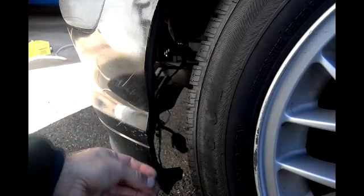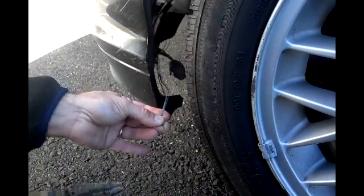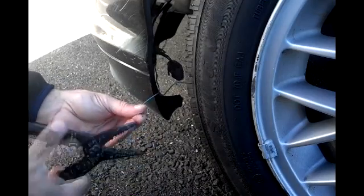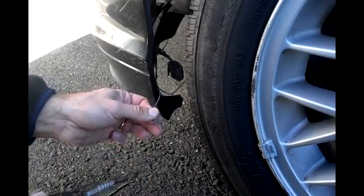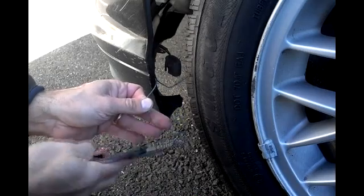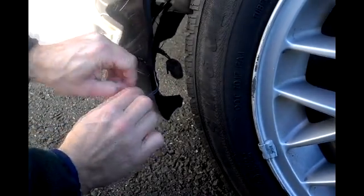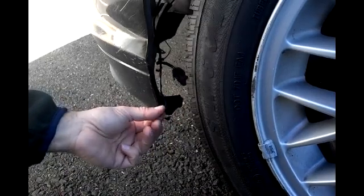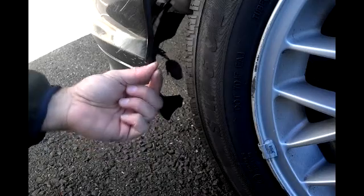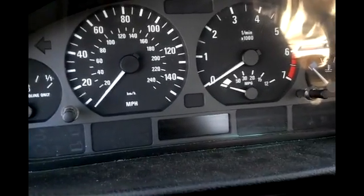You saw it read negative 40. I'm going to take some wire strippers and just take a little bit of the sheathing off for both of these wires. I'm going to take both these two ends and touch them together. This is another common problem you'll see — say they got chafed and the wires are touching together, or when it gets damaged, the ends end up touching together. My wires are now shorted together — they're no longer open.